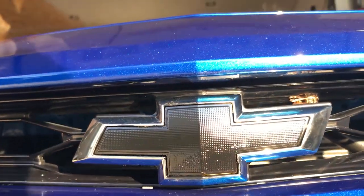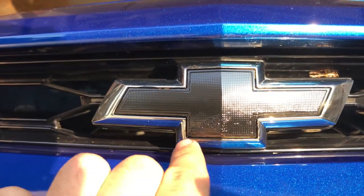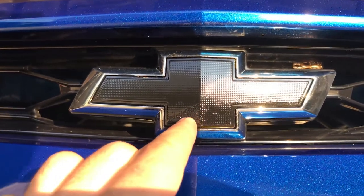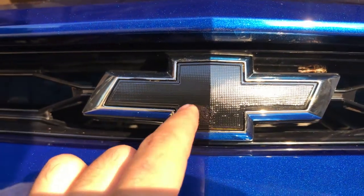You can easily take the overspray off with some solvent — just don't get it on the paint of the car. On the front there's some overspray right here as well, some minor spots on the edge you gotta touch up — probably from spraying too close or spraying too much. I'm gonna take some sandpaper and wet sand a little bit to take it off. All you need to do is get some fine grit sandpaper, some water, wet sand a little bit, get that overspray off, touch it up, make sure it's all nice, and it's pretty much all done. Take a look at it in the sun though.